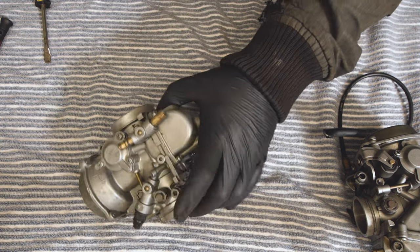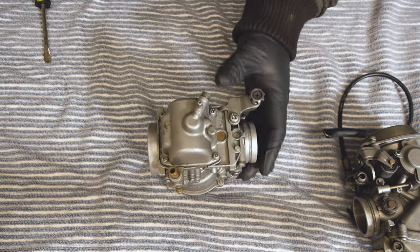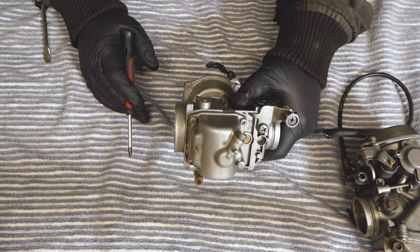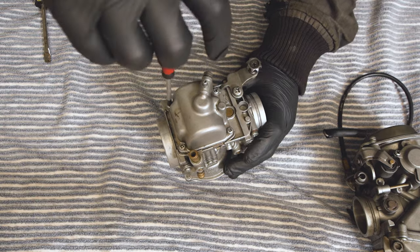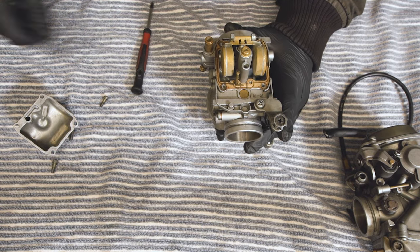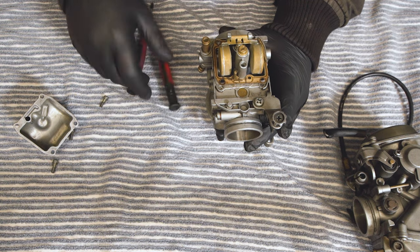And if it is running, it's not running the way it should be. So the first thing you're going to want to do with these carbs is obviously get them out of the bike — I'll put a link in the description to the video showing you how to remove them. First thing I want to do is take this float bowl off, because this float bowl is going to tell us what condition the carb is in and, by definition, what condition the entire bike is in. Grab the correct size screwdriver and start undoing these screws. Once you've taken the float bowl off, you'll notice a couple of things. You've got a gasket — make sure you've got a replacement on hand before you start, because if you haven't changed it for quite some time there is a very strong chance that it will perish.